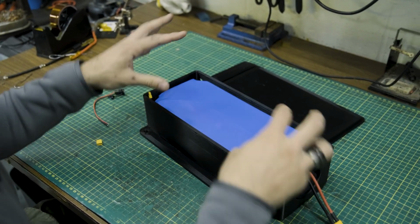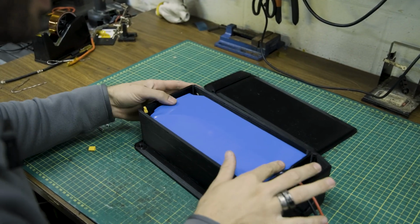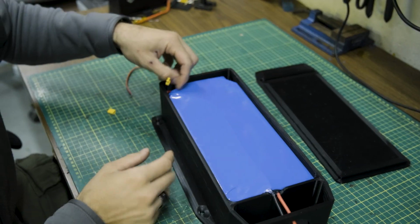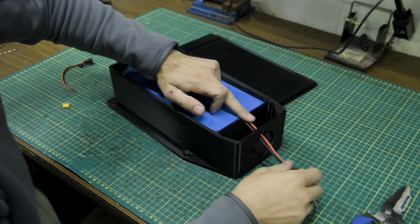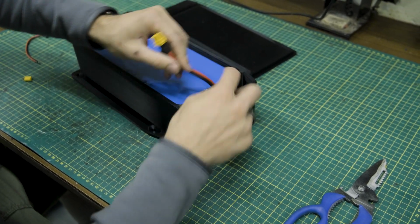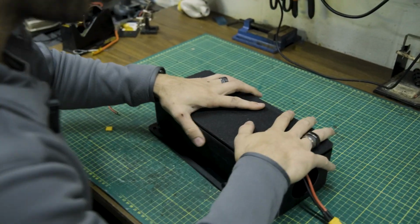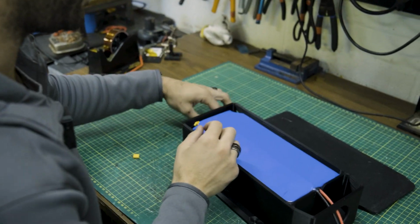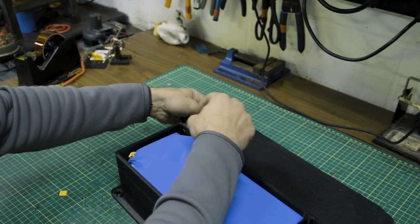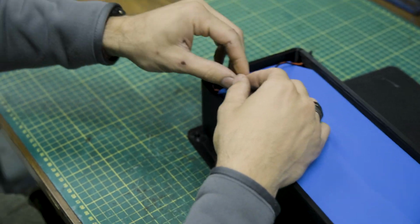Awesome, so we have the battery now placed inside of the container for the RadPower rear rack underneath battery. As you can see, it fits in there nice. It's a little bit tight, which is okay. We'll probably adjust the model a little bit so there's a little bit more clearance for the next ones, but it's pretty good. So we got our discharge cable coming right through here. This is the area where you can run a parallel module if you'd like. A parallel module just fits in there. And we've got our lid, which is going to seal all this off. And it's got the 2 different sections, screws going all the way in. And the last thing that we really need to do is install this charge port. So I'm going to feed this through, solder on an XT30, plug into this XT30, and then I'm just going to tuck it into this little space here, and from there we should be good to put the lid on.